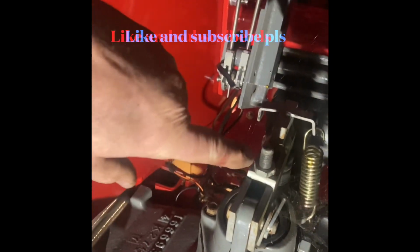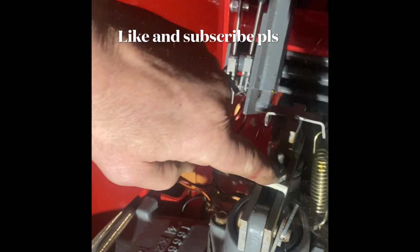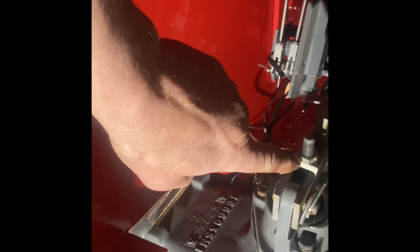Yep, under the 1250 again. This time we're adjusting the brake set. So here's what we do. On the bottom of the slave cylinder here, you've got the rod which comes out the expander. So that nut there, you'll see at the moment, we've got it jacked up so we can turn the wheel by hand. Obviously you've got to jack both sides up at the same time so you can spin them because of the diff, because it's permanent 4-wheel drive. So what you do, you tighten this nut up until you can't move the wheel by hand, then you slacken that nut off 6 flats, and that should be about right, hopefully.